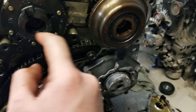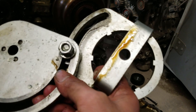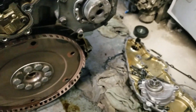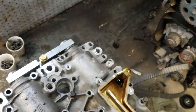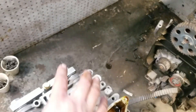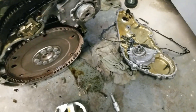Your pulleys are locked in the exact spot they need to be on the cams. To lock them to the cams, tighten these two bolts: intake is 110 newton-meters, exhaust is 75 newton-meters then 90 degrees. To tighten them you also use this tool — it's used to both loosen and torque the bolts. Don't think that because you have this tool on here you don't need that other tool. This tool is not designed to hold the cams in place — you will crack the end of your camshaft if you do that. The old five-cylinders are designed for that, but for the six-cylinder engines this tool is designed only to hold it in the timing position.